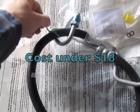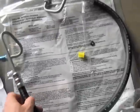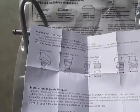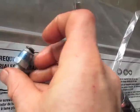The parts I got for the power steering pressure hose — in the package I got the hose, the cap, and the two O-rings. It gives you the instructions. First step is to lubricate the O-rings, so I'll dip my finger in here. And then slide these over the ends — this one and this one. So now I have those over the ends.